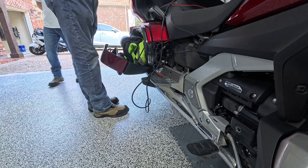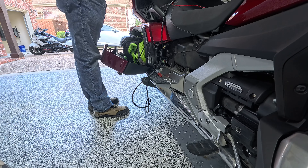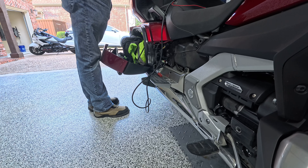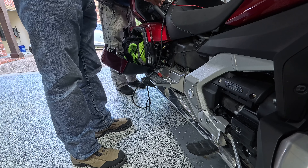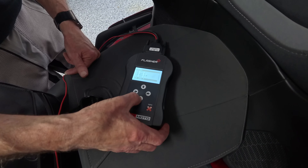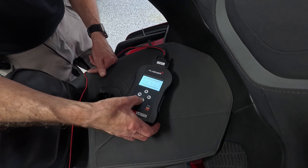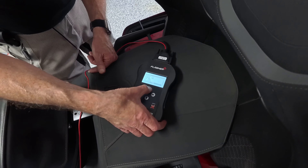Next, I connect the BT Moto flash unit to the positive terminal of Tom's battery, and we also plug in a battery tender. In the flasher, we click work. Okay, it's already clicked. Then we select the motorcycle brand. I'm going to select the CBR... GL-1800. There it is.